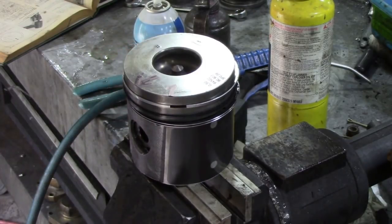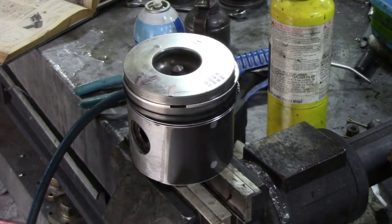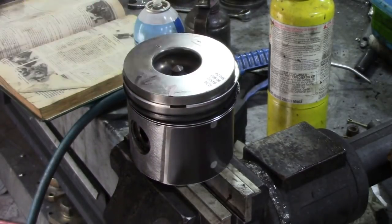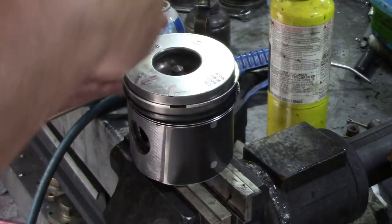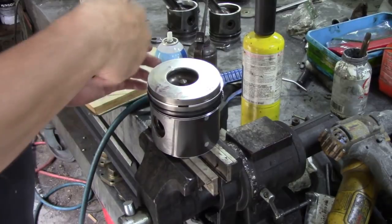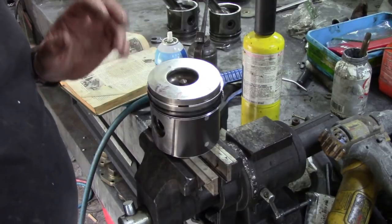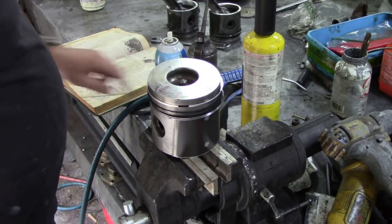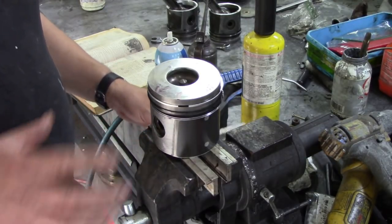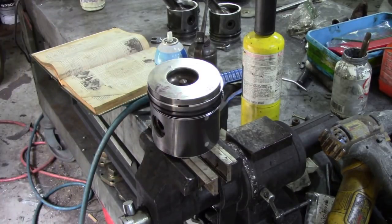The reason for that is that I think the camshaft side is the thrust side, which is this side. So all the thrust goes this way when the piston's going down — we don't want any gaps there because it could make a little bit of a groove. So I'm going to set all of them up, clamp the rings, and then put them in the block — which is a job I don't like doing.